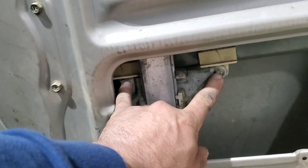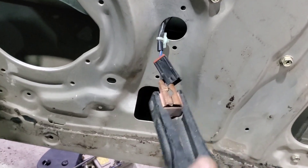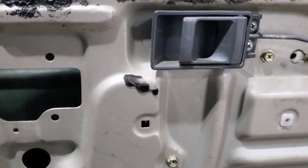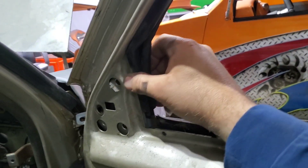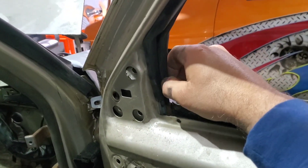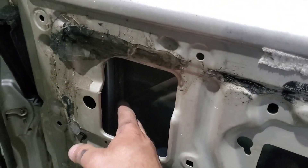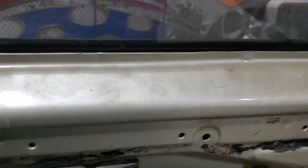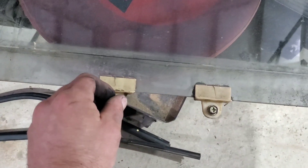It ended up being just this opening right here, so you just take the window down to that opening and you can unbolt both sides. I can now also remove this seal here — it should just pop out. It will actually go down in that track so you pop it out from up here and then pull it all the way out of this track. The window kind of needs to be out because the window is holding it in right here, so I will pull this glass out.